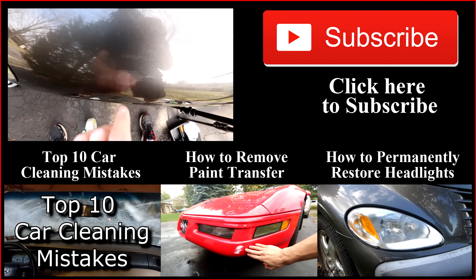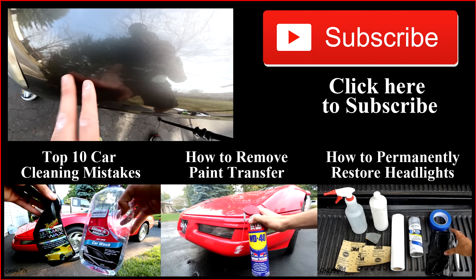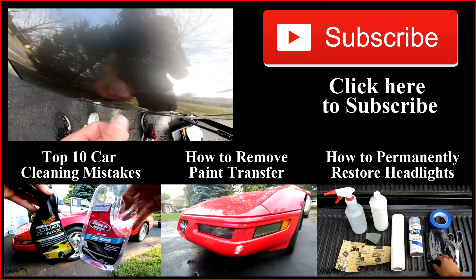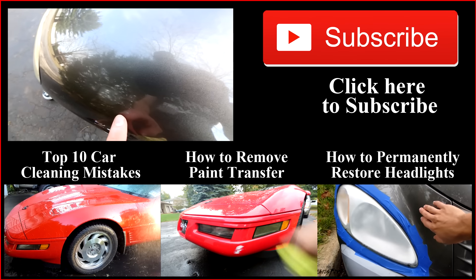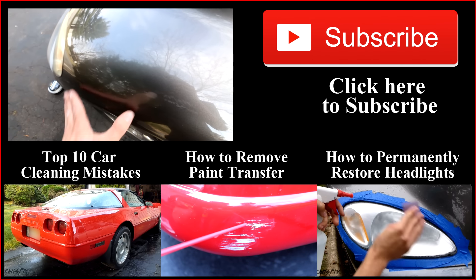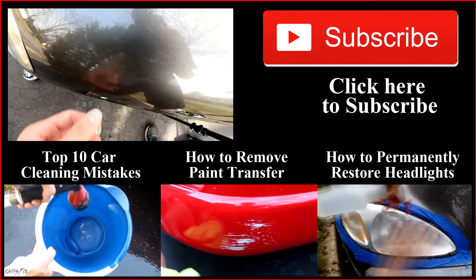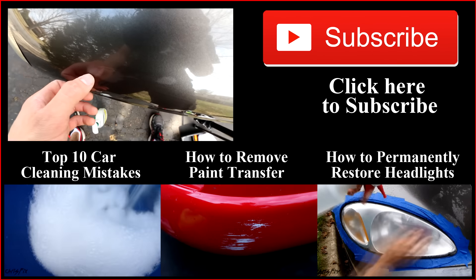The top tip for this video is: you can see right here where I sanded completely through the clear coat. So if your scratch is too deep, you don't want to sand too far. Even if the scratch is still there, you might have to stop — otherwise you'll burn right through the clear coat just like this. Then you'll have to spray clear coat over the area, sand it down, feather it in, and do all that extra work. So just be mindful with your clear coat, because too much sanding will do that.